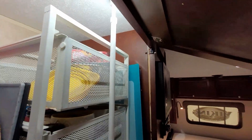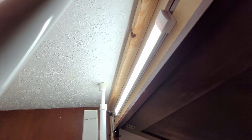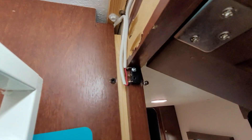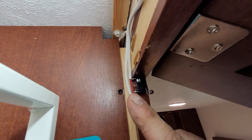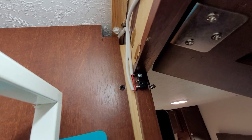The light itself is a 12-volt strip light made by Alpina — a Princess Auto buy. For those in the States, Harbor Freight is very similar. Any 12-volt lamp will work. We're stealing power out of the light in the bottom of the cupboard and wiring it up — it's not the most elegant thing, but you don't really see it. It's just a couple of wires up into the bottom of the switch. You need to position the switch so that when the cupboard door closes it trips it and turns the light off, otherwise — especially if you're boondocking — you'd have the light on all the time.